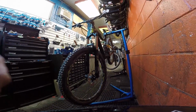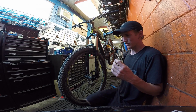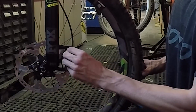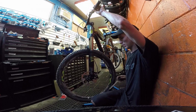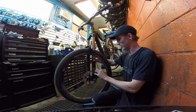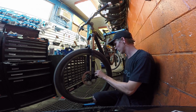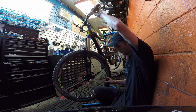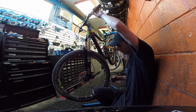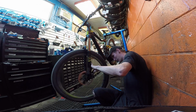Maybe I'll bring you guys a little bit closer so you can see kind of what I'm doing. Alright, so what I'm going to do here, as I check my back off the wall, right now this is loose. I'm going to pull the brake, tighten the bottom one, and by tight I mean snug. Give it a little spin, rubbing, so play with the top one then. Oh, almost. I'm gonna start over. Loosen them both, tighten her down, snug that up. That's what you want. You want to spin it with no sound after snugging it.